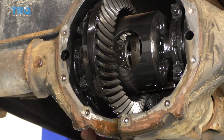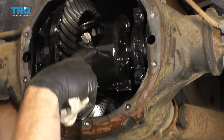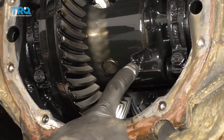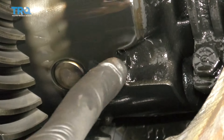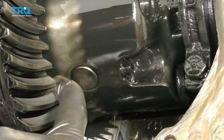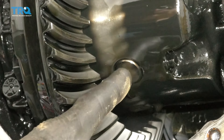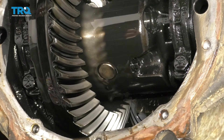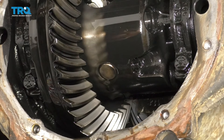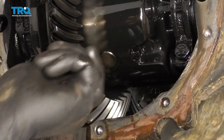The next thing we're gonna do is grab onto that rear driveshaft and spin it. We're looking right inside for this pin and this bolt. When you take out this bolt, it's gonna be a long bolt that comes right straight through the pin. There's a probability that once the bolt is out, this pin is just gonna want to slide out — and that's hardened steel. If it slips and hits the ground, especially on pavement, you could chip or damage it. So take out the bolt carefully, grab your pin, and slide it out.